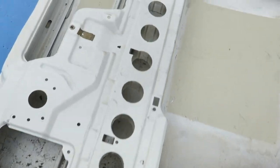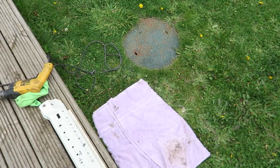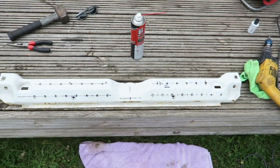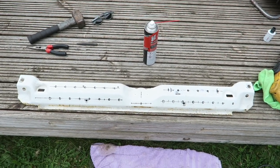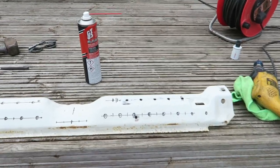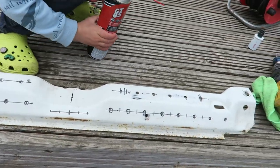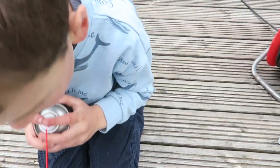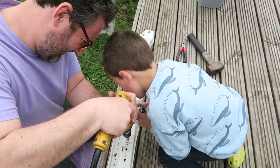Just doing a bit of work at home. I've drilled a load of holes out of the door — getting a nice bit of weight out. I'm putting it all in the bucket so I can weigh it at the end to see what it's like. Now I'm doing the front cross member panel — this isn't overly structural, it just holds the two top parts together. On the long nose they don't actually have this, it's more of a plastic part near the top of the rad. I'll probably make it in carbon fiber eventually but for now I'm just going to drill a couple of holes to get it nice and light. I've also got some extra help — haven't I Leo? So can you come over here and spray some of the oil? I'll pass you over to Lex so she can catch Leo doing his bit. We're just spraying a little bit of oil while I'm drilling. I've already punched the holes in the top so the drill bit doesn't go wandering all over the metalwork. Good boy.